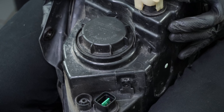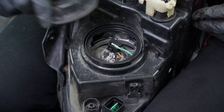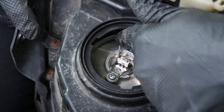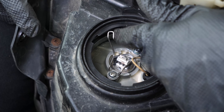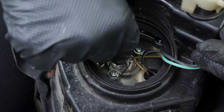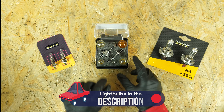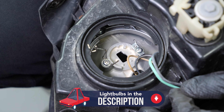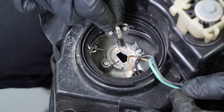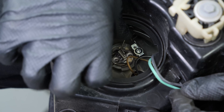To replace the H1 full beam light bulb and the side light bulb, unscrew the grille side cover. Remove the electric connector for the light bulb by pulling on the back part, not on the wires. To take out the bulb, move the lip on the holding spur outwards. Pivot the hook, then remove the bulb. Take the new bulb — when putting it back in, it is important to consider its orientation. Identify the keyed connections, then move the metal clip back up and reattach the connector.